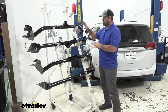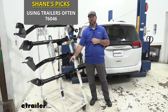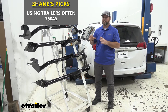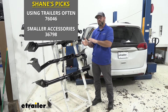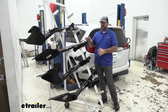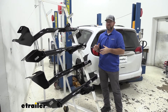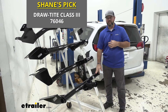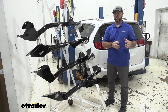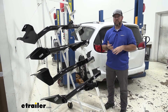My professional opinion: if you pull trailers more, go with the Draw-Tite class three — it has a pre-welded bracket and you're going to need lighting. If you don't haul that many trailers — maybe smaller trailers, kayak carry trailers, or something like that — out of the two class two hitches I will go with the Draw-Tite. The reason I picked the two Draw-Tite hitches is because the receiver tube is hidden behind the bumper fascia. Out of the four hitches I'm going to go with the class three Draw-Tite — even if I didn't pull many trailers, it gives me the availability to haul when I need to, and I can still carry bike racks and cargo carriers.